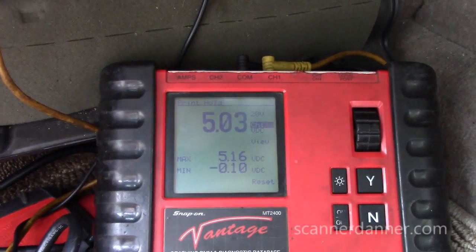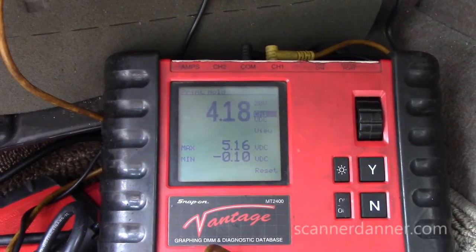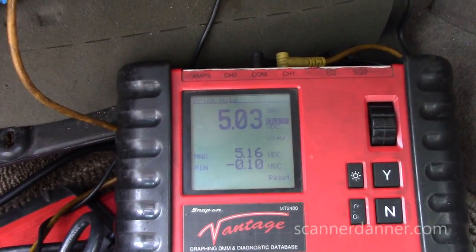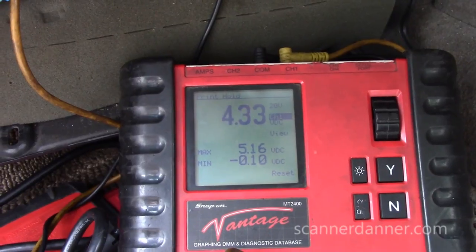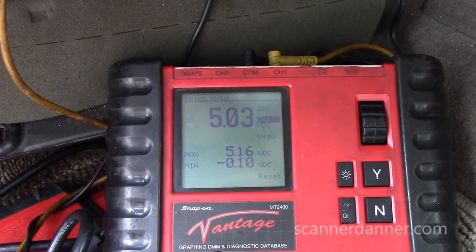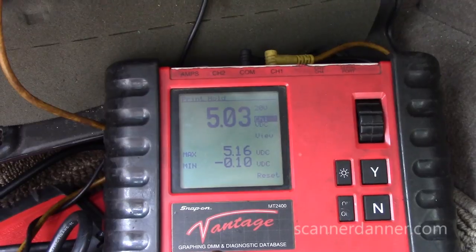On that one, when I put the key in, this is gonna load the circuit. The second you put the key in, this should drop. It looks like I can almost make it, just wiggling the key. Sorry about the buzzer. You see those voltage changes there. So what we have is a messed up tumbler, it looks like.